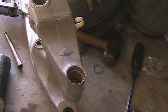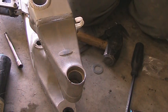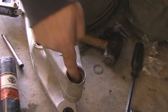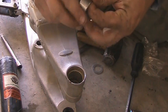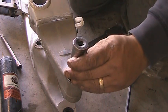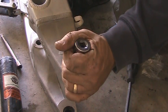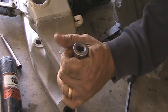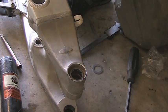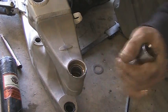I'm going to apologize for the quality of this video — I'm trying to get a lot of things done today, so I'm kind of rushing through this one. For the outer bearing, same thing: numbering goes towards you. Dab just a little bit of grease in there on the bearing. Again, the best way is if you have a press, but I'm not putting a lot of force on these. Now, the outer bearings are going to be flush with the inside of the lip, so I've got it about there. I'm using a bigger socket so I can get it exactly flush.